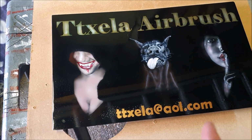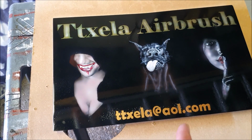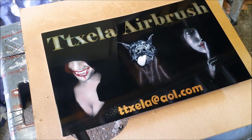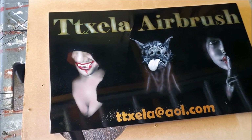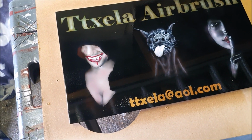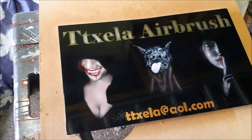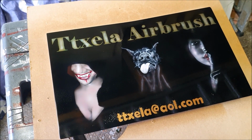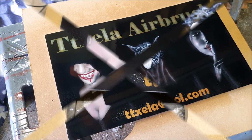I think what might be an issue is the black base coat, which is just a Halford's aerosol spray can. That's why I want to start using proper car paints, because I think where I've had this happen before, it was on the Halford's paint. So I don't know what's causing that, but we've got to try and get around that somehow. Anyway, this needs to be left for 24 hours for sure.